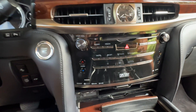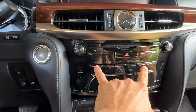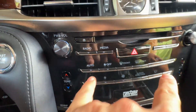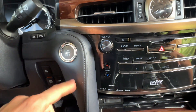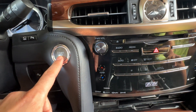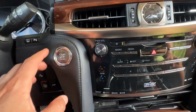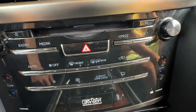In order to go into diagnostic mode, you want to start with the vehicle off. You want to hold the auto and the recirculation buttons — that one and that one — and while you're holding them, you want to start the vehicle. Put your foot on the brake and start it. If you're in a garage and can't start it and you have a push button start, you're going to have to tap it twice without your foot on the brake so that it actually turns on the HVAC system and the computer turns on.